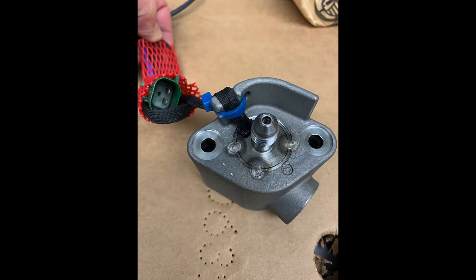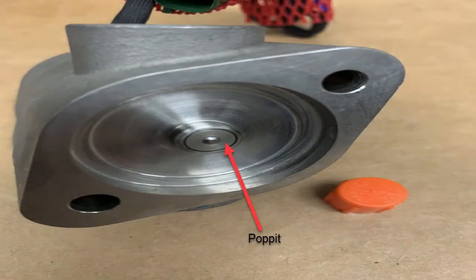The injector is bolted on the pipe with two bolts — you'll see the gasket a little later. The ECM can log fault codes on the electrical part of the injector and the mechanical part if it thinks it's injecting but sees no heat in the after-treatment. This is the bottom of the injector, the part that's bolted on the pipe. You can see there's a large open area around the center — that's where the big, thick heat gasket goes.